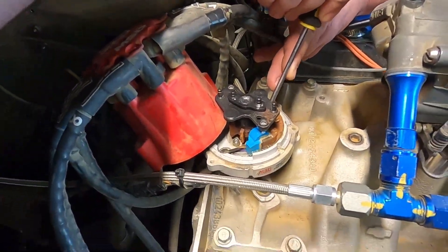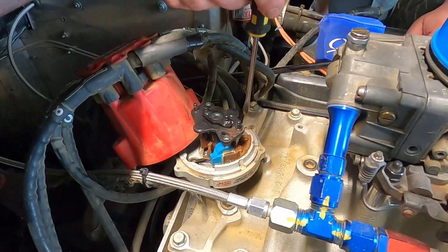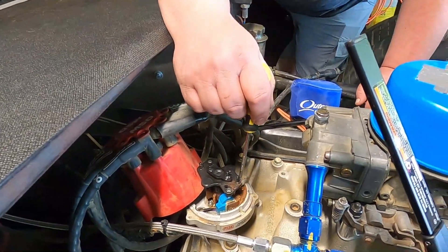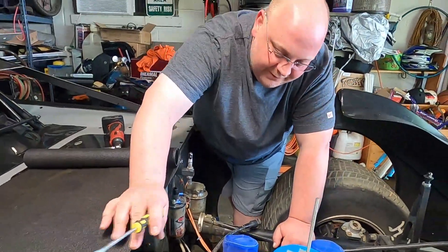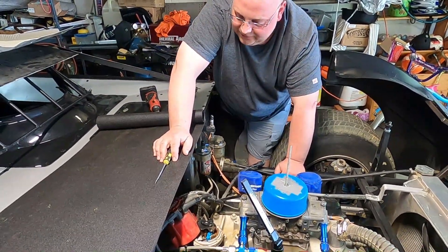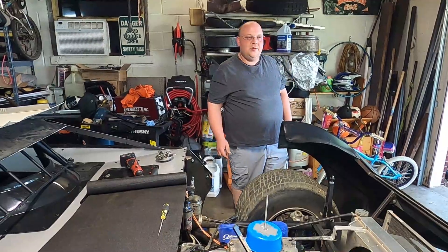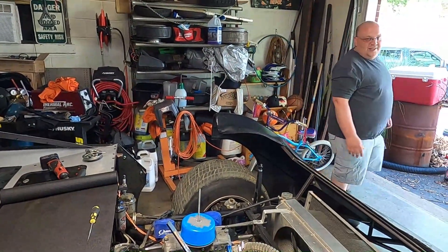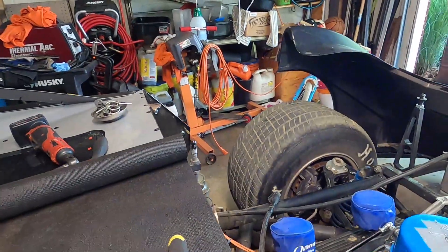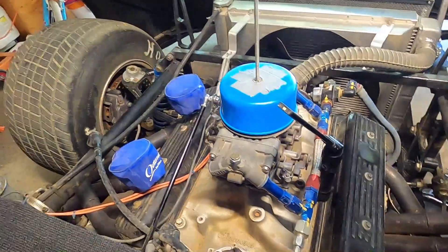We need to clean it all up. Having rust isn't really a big deal because it runs off magnets - it's still an iron surface for the magnetic field to pass through. But it's pretty rusted and pretty old, so we're going to take it out and replace it. We need a 3/8ths wrench or some sort of Allen socket to slide underneath and try to do this without pulling the distributor out. I checked and there are no YouTube videos on this.